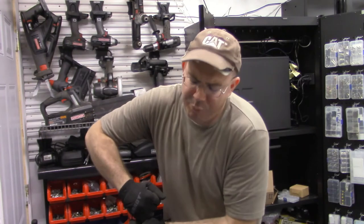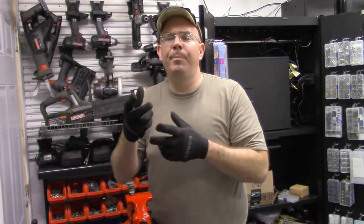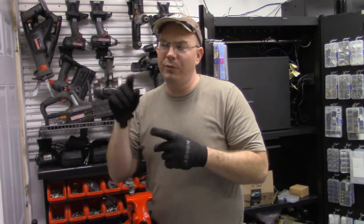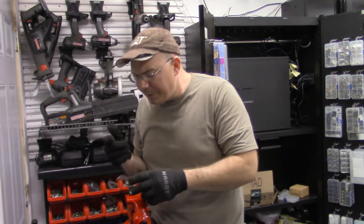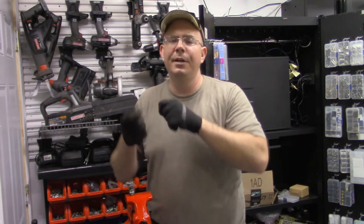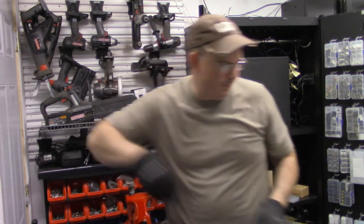And then they press these metal grommets into the gas tank because it's plastic. Then you tighten the bolt into the grommet that's inside the gas tank. And what's happened is either somebody touched that, or over time, it only got one good torque on it. And what happened is the inside grommet that's in the plastic of the gas tank basically was just rounding. It's like it was rounded off. You couldn't catch it from the inside of the gas tank to remove it.